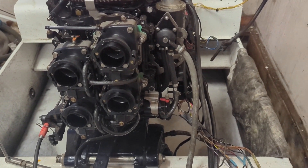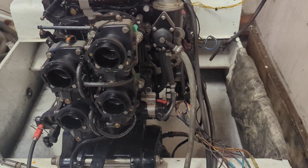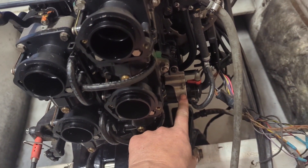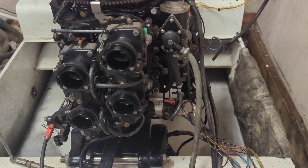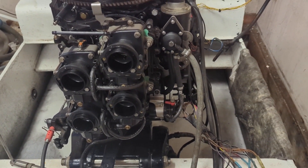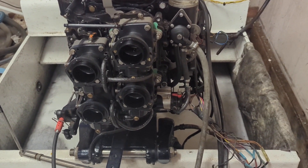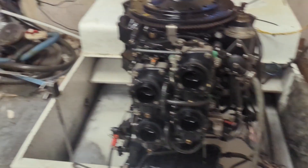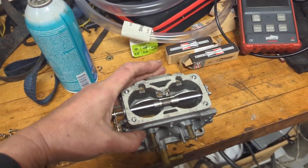The enrichener is a commonly misunderstood, commonly misused part of the motor. It's commonly called the choke, because that's what it was called for decades — when you have to move a lever or push the key in, it's called a choke. But the reason it's called a choke is because before this, the choke was on a carburetor.